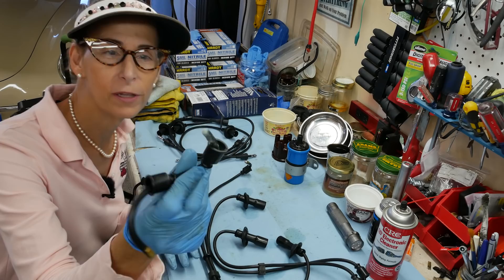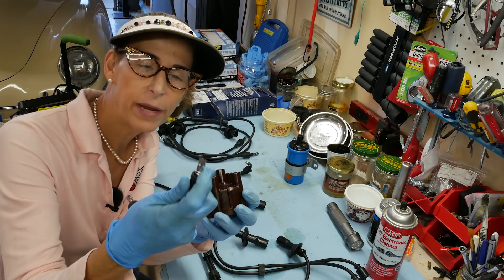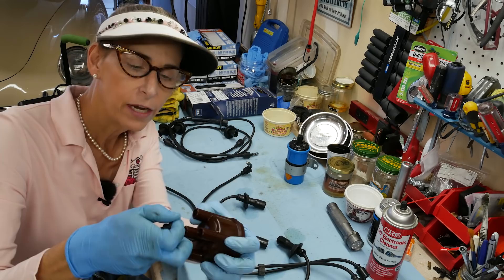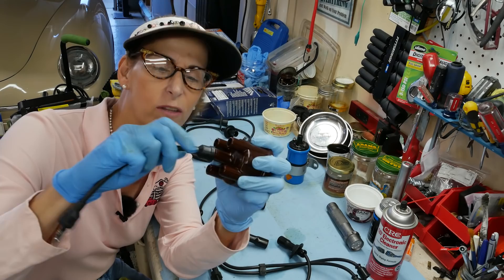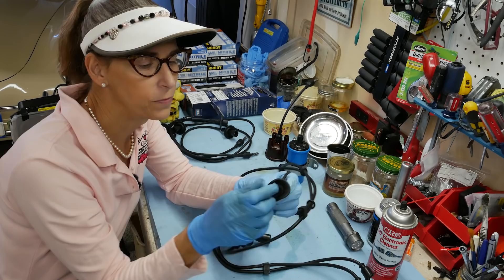The one wire we don't have to fuss with is the actual coil wire itself — look at that, it's horrible. We have a new one right here, so we don't have to worry about that. The best way to put these on is to make sure the rubber cap is pulled back so you can see it going in all the way. Work it back and forth until you feel it seat — you shouldn't see much metal at the top. Then push the cap over the top.